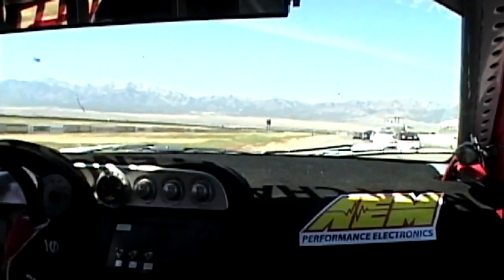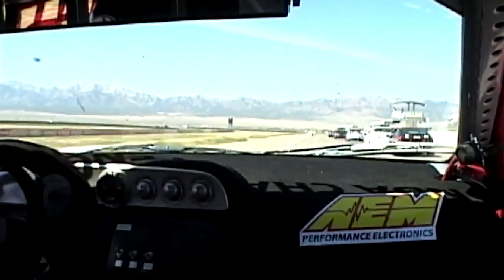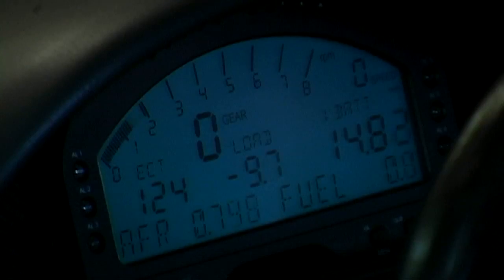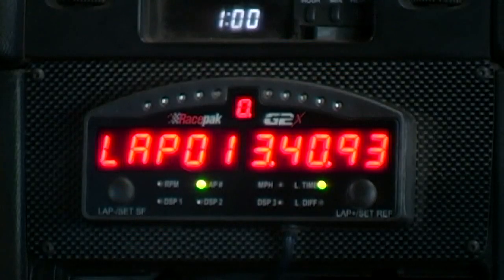Run the X-Wi-Fi in a race car, and instead of monitoring your air fuel on your iPhone, you can data log to an EMS, an FIC, an AIM dash, a race pack, or anything that can take a 0-5 volt input.